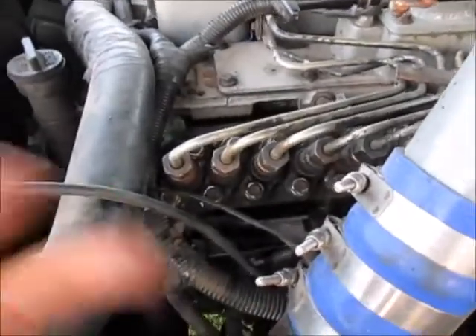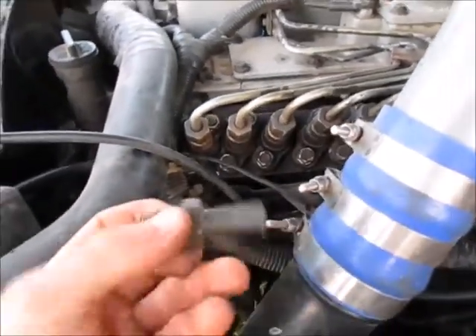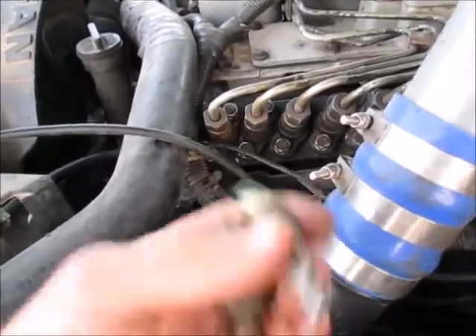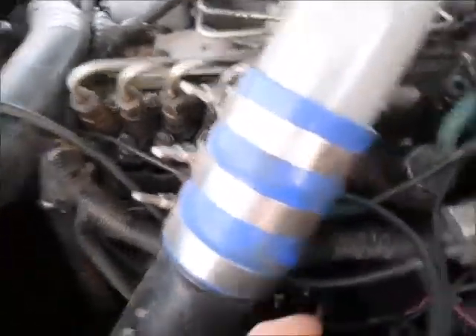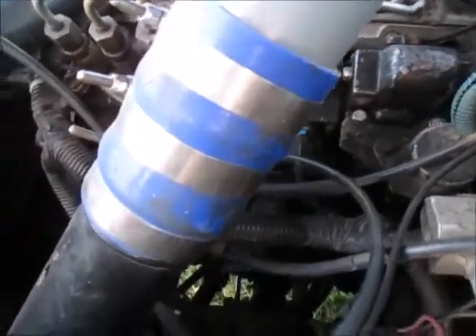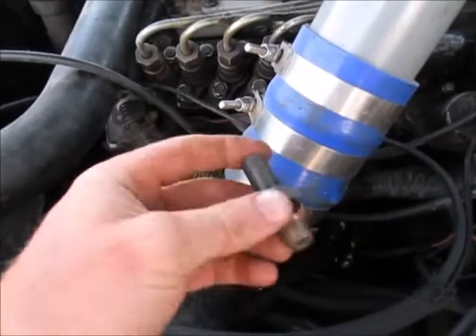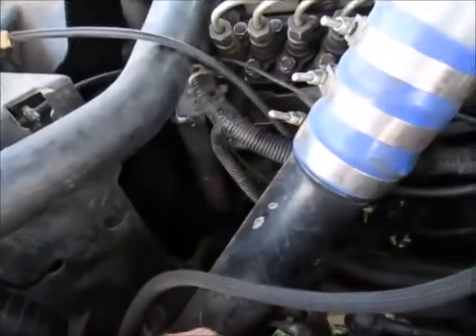You don't even need fuel pressure from a fuel pump. If you've got an electric fuel pump, sure, use it. But if you don't, it's just as easy to hook up a Schrader valve or an air compressor quick connect fitting to the fuel system somewhere. You can remove the banjo bolt that would normally be right there and put a fitting in, or you can buy one, or I drilled out a bolt that's the right size and put a quick connect fitting on that.